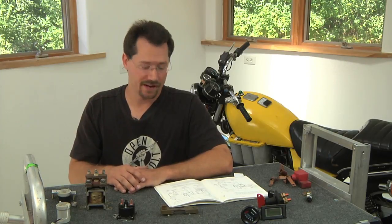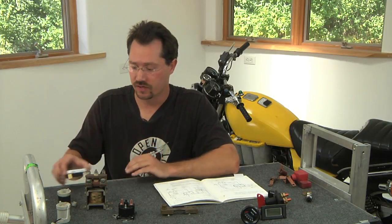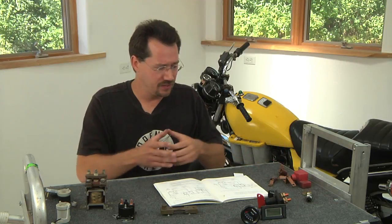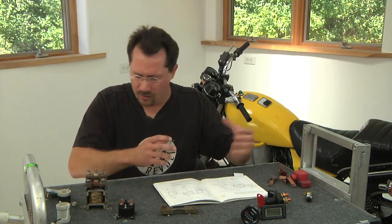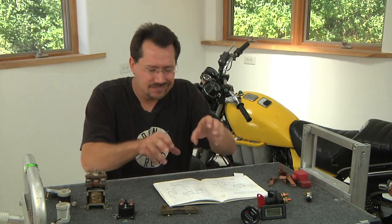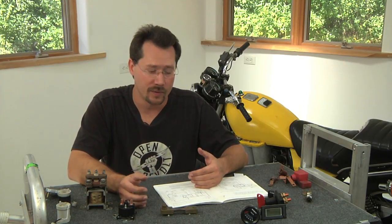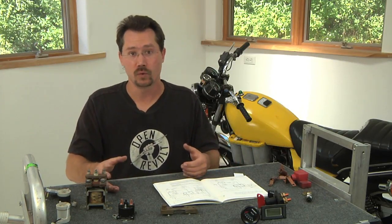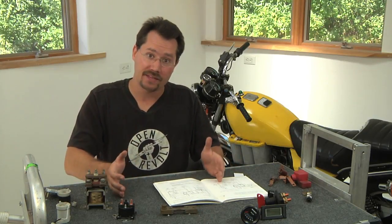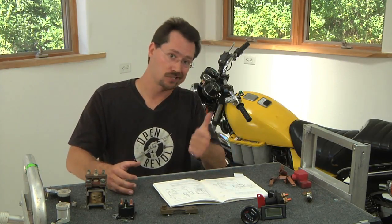One more thing that doesn't show up in this diagram is the DC to DC converter — we'll cover that in detail in just a couple of minutes. Now, we've got all these parts and the diagram, but how do we put this all together? If we're trying to assemble this one at a time into the motorcycle, how do you mount everything? This is where cardboard-aided design is going to come to your rescue. Instead of trying to attach all these individual parts singly to the motorcycle, it makes sense to connect them all onto some sort of sub-panel and then have that entire sub-panel mounted to the motorcycle.